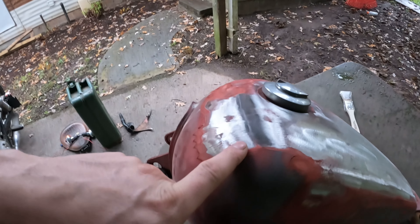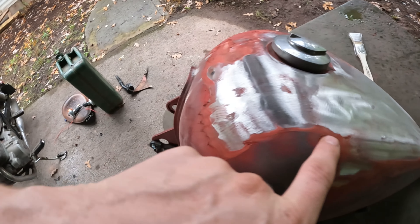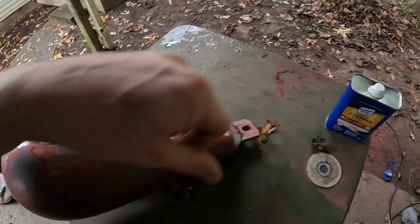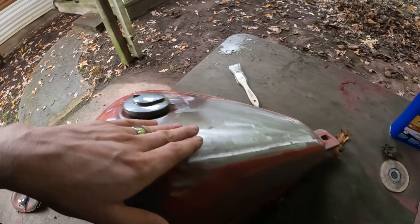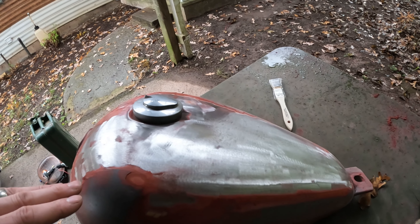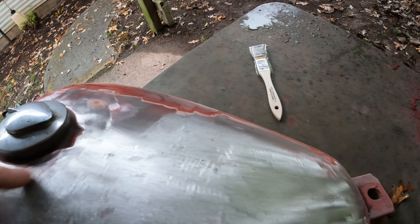Yesterday I did — I'm not going to show you because you can't see it yet — but the two fenders are sitting right there, they look pretty decent. This does not, as you can see. We had to start grinding the paint off because there are about seven or eight different layers of paint here. So I got some chemical stripper, we're going to put that down, get the rest of this paint off, give it a good sand, put down a good primer, and then lay the paint over top — that way we can seal off the bare metal so it doesn't rust like it's starting to already.